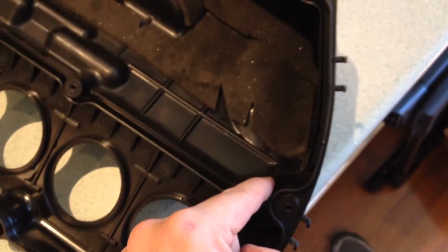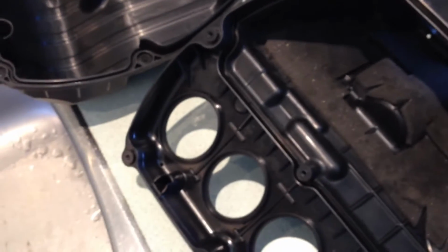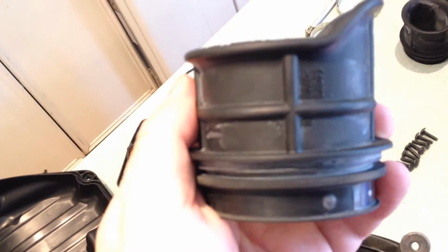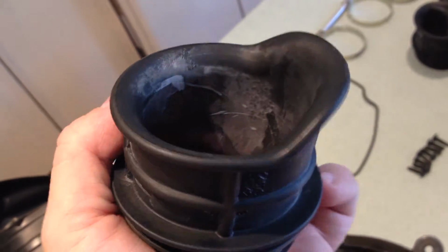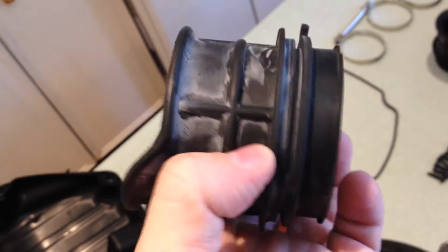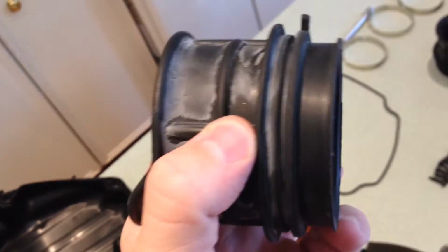And of course I removed the rubber gasket that was in there in order to clean it properly and rinse it, because the rubber gasket doesn't get manufactured with the injection molded plastic housing. So I usually take it apart, and I took off these rubber chunks as well that are the inlet pipes for the throttle body. There you can see it's waxy. I did not wash the waxy bits, I just cleaned these grooves with compressed air, that's it. The outside of it is not too critical, the inside of it is more so. That's where the air travels before it enters the engine.